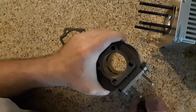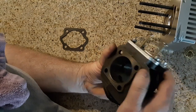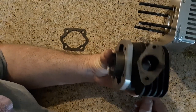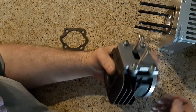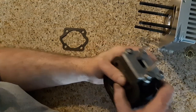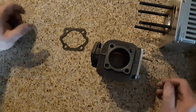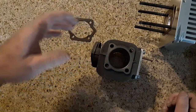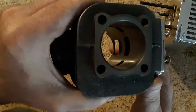On the cheap end these are $60, on the aluminum side they're roughly $160 for the jugs. You'd also have to find some way to get an exhaust — there are tons of people making them now for Minarelli builds. You want a VM20 or VM22 carb. The VM20 is almost perfect usually, right in the ballpark, and so is the VM22. The PZ20 carb that everyone is pushing now — you can't buy jets for it, and a lot of times when you run it, you scar up the inside of the thing. This one has hundreds and hundreds of miles on it.